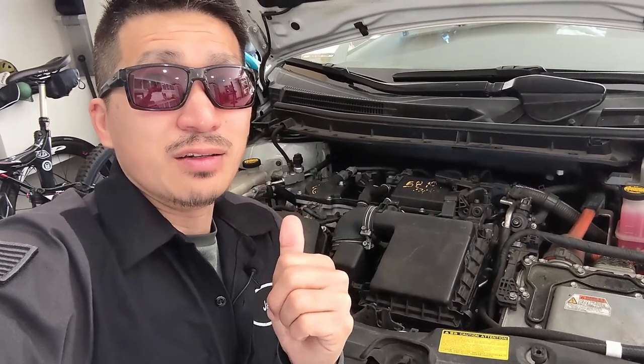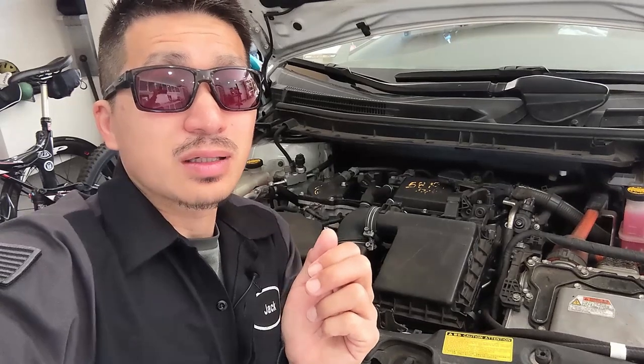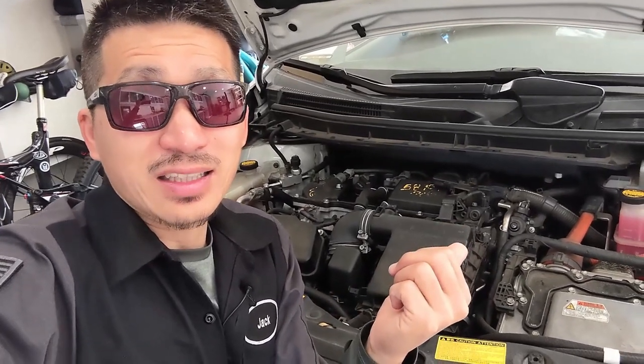So I used the Dr. Prius app to reset the error code twice at the beginning, and now it's been a couple days, I don't see any error code. So I think it's just a temporary fluke. Other than that, this engine is running smooth and running very quiet. Pretty sure that Toyota had done some small improvements on it, for example, the oil consumption or oil level sensor, right? And also, like Tony said, the extra heat sink to the head gasket to eliminate the warping issue for good. So only time will tell.